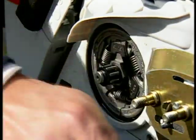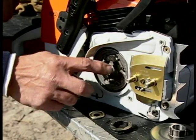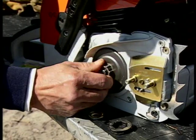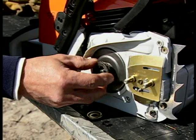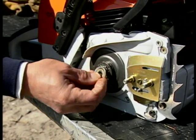Now you can easily clean your parts and reinstall them, making sure to add a slight amount of high-temperature grease to the needle bearing and crankshaft. When reinstalling the drum on your STIHL saw, rotate it about 1 turn to make sure that you've engaged the oil pump drive. Slip on the rim and reinstall the washer and E-clip.